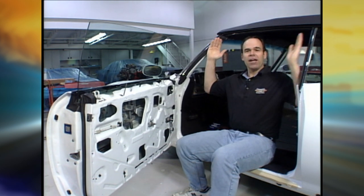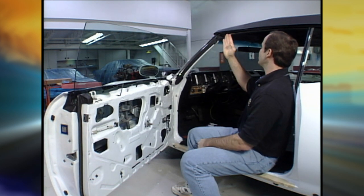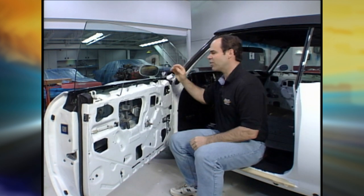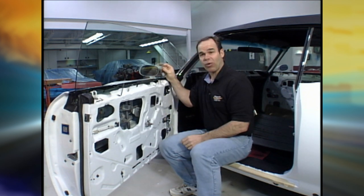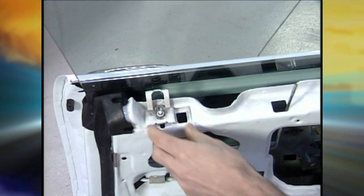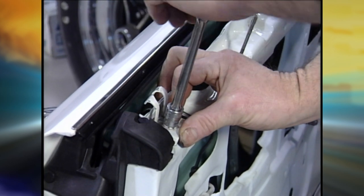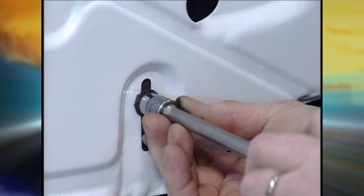You've also got the issue of making sure the glass follows the A-pillar and seals tight up against the roof. The adjustment there is fairly limited. You have an anti-rattler — you want it to push up against the outside felt, and you use that anti-rattler to make sure it doesn't rattle when going up and down. Once all the glass is set in place, we've got to adjust the door card. These two brackets allow us to move the door card in and out. There's a felt on the top of the door card that allows it to push up against the glass and keep it from rattling.